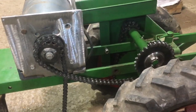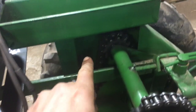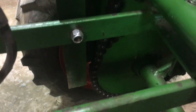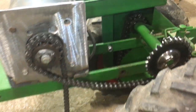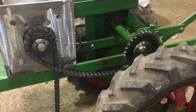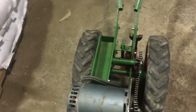It's just about ready to get trimmed and then I've got to make a chain guard, and then the jackshaft runs over to the original second stage which is one size bigger chain. This one here is number 40, the other one is 50. I don't really know roller chain sizes. So yeah, that's the plan and it looks to me like the motor is a good fit.